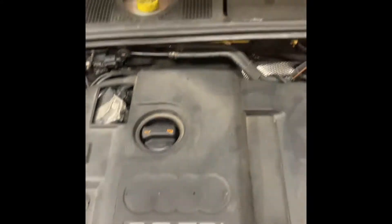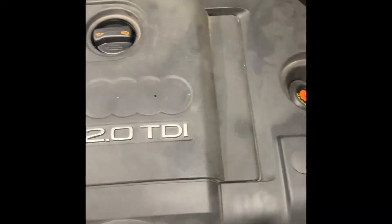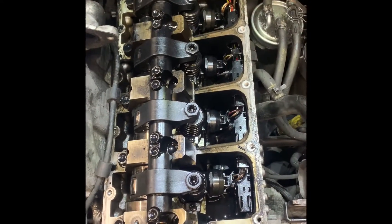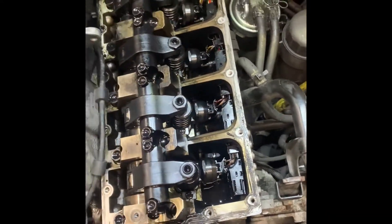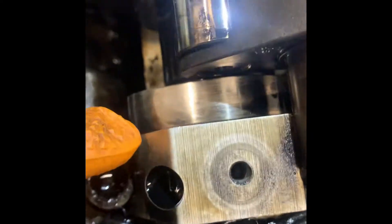Get the top timing cover off and have a look inside the rocker cover to see where we go from here. We've got the rocker cover off now — undone the bolts around the outside and taken it off. Looking inside, it looks like the camshaft has got excessive wear; the lobes are almost worn down to round flat spots on them. I would imagine this is going to be our problem for our noise.